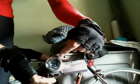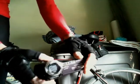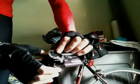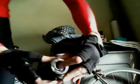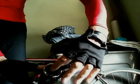Here's the camcorder I used. Now watch — when I turn the power off, the lens cover closes automatically. You see that? That's what it was doing on some of my videos when this camcorder was shaking a lot or when it hit a bump, the lens would close. I found this out by holding the lens from opening when I turned the power on — see it try to open, but I stopped it.